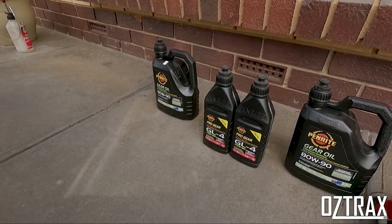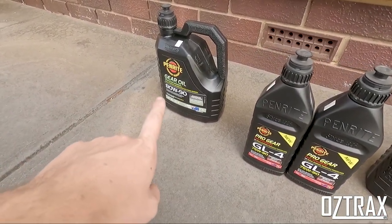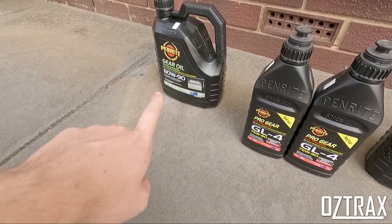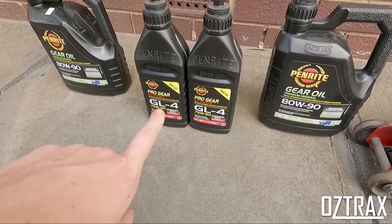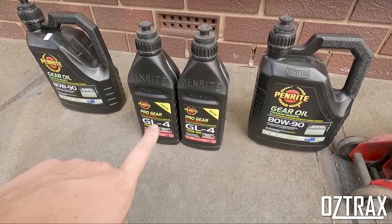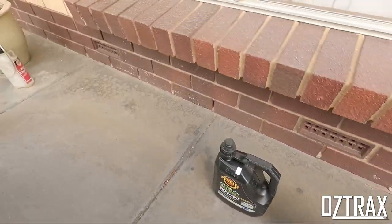So the oil required — from left to right, that's your front. Your front and rear diff are the same oil — they're an 80-90. For all diffs including limited slips and manual gearboxes it's 80-90 for the front, 80-90 for the rear, and then your 75-90 for your transfer case. I'll show you underneath the vehicle where your drain and fill plugs are.